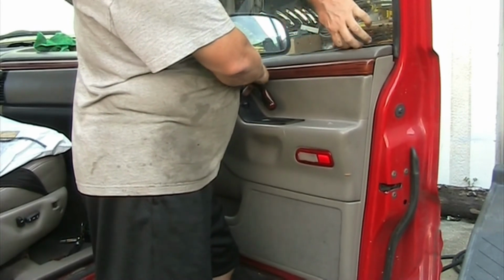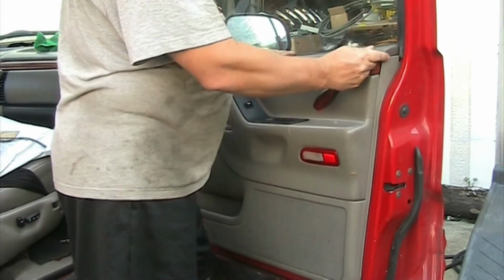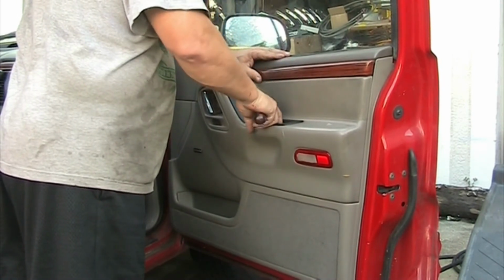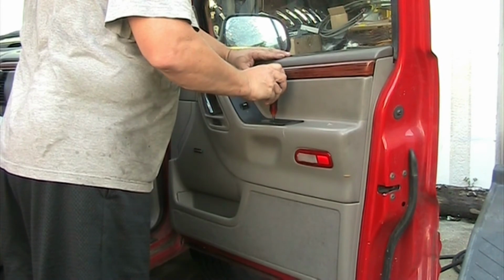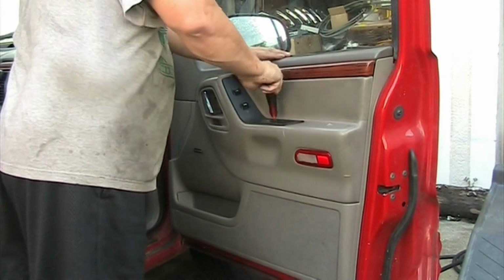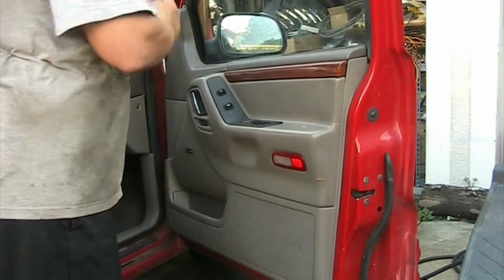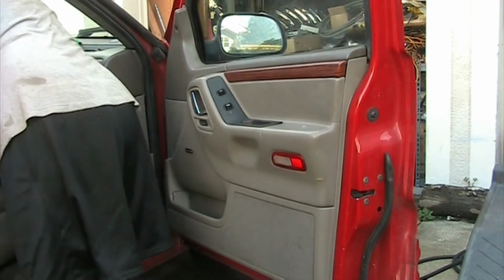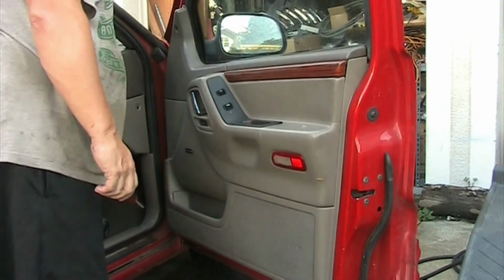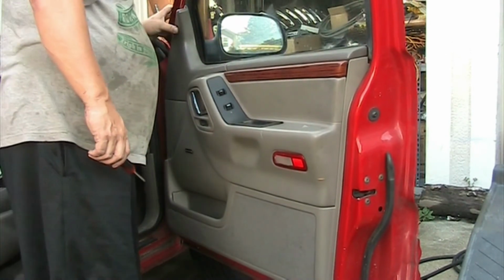And if your rubber lip is being folded in, you can use a butter knife at the end. Just run it underneath, and that will cure the situation so you get the lip out without destroying it. So once you have this Phillips screw in, your whole panel is already holding in place. Then you only get the additional screws if you would have them. I'm missing this one. This was an alternative they put in there, so I have to replace that.